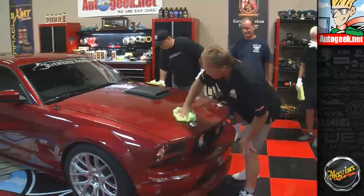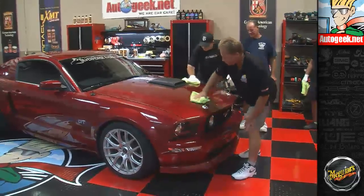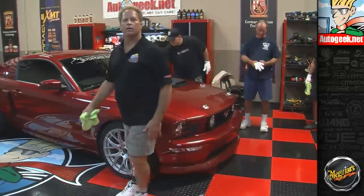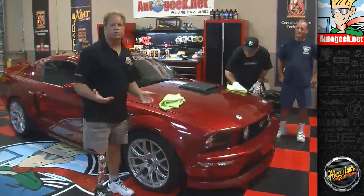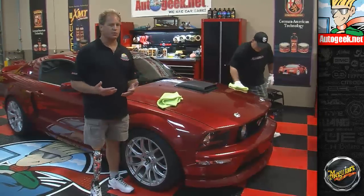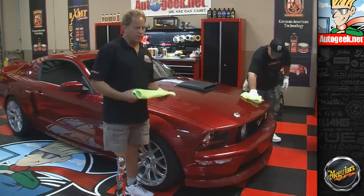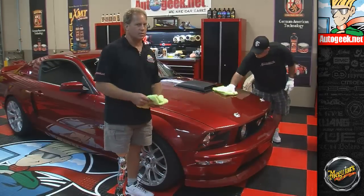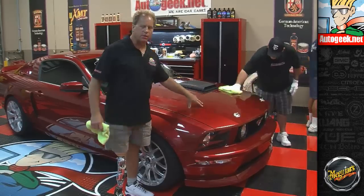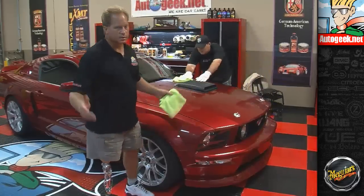But again, you would do this about 12 hours after you wiped off the M21, 12 to 24 hours. In my life detailing cars, I never did that, because a lot of times I work on someone's special interest car. I'm driving from my house to their house, sometimes 100 or more miles, or you're flying into their place, and you don't have the liberty to wait a day to put the wax on. So I let about 30 minutes go by after I wipe off the sealant, do something else, clean up, then I put the wax on, wipe it off. That's as good as it gets, you know.